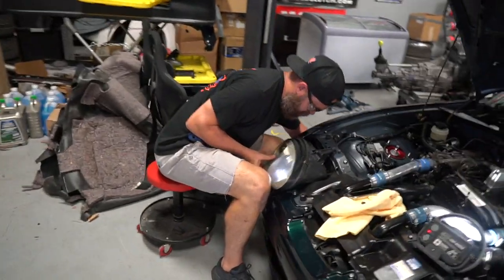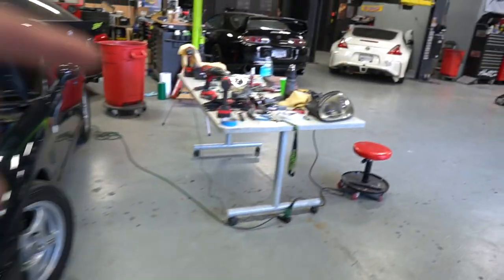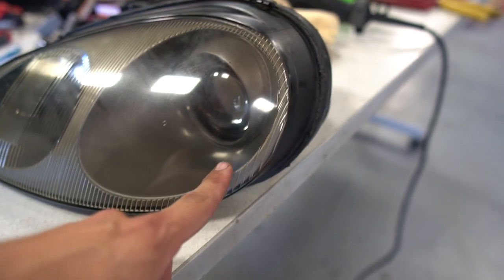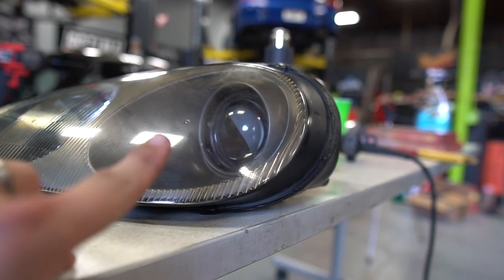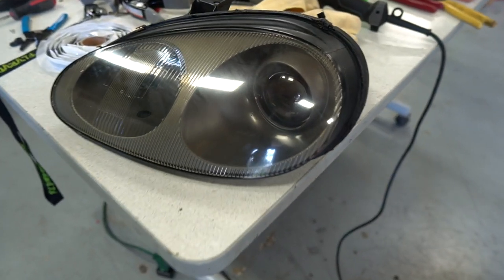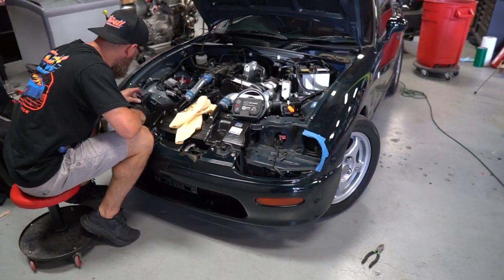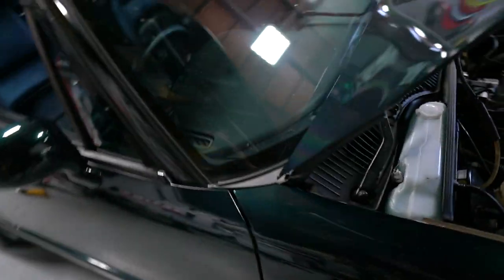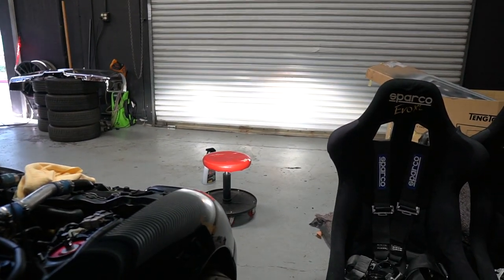At the end of the day, if my dude can drive at night and see much, much better, then that's really all that matters. The big crazy part about this was the bi-LED — it's got the high beam function with two wires coming out the bottom of the projector, and there's also a cooling fan. We took off the little cover for that, so we had to reroute the wires after having already sealed the light. It just made it troublesome — you feel like you're done and then you're tearing it all open again to reroute wires and reseal. But I think our seal came out better the second time anyway. They're still not aimed — we've got to go up with them.